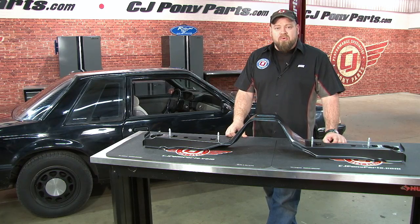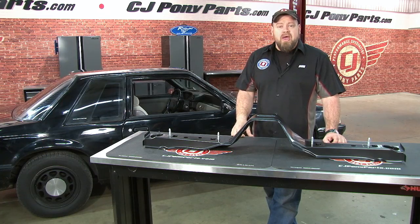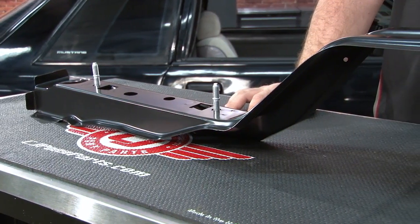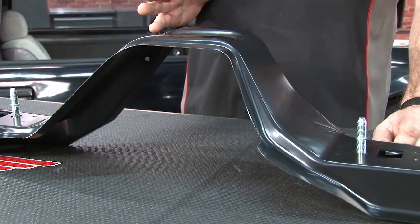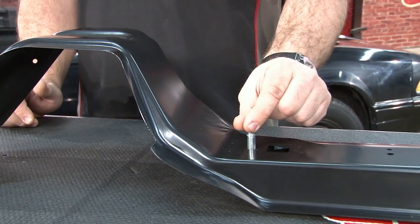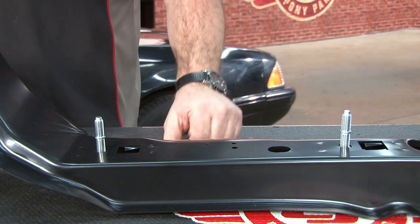The owner of the car plans on doing a lot of the work himself, but one area that needs help is the crossmember. The crossmember is a weldable part and a lot of people have asked how to install this, so today I'm going to show you how using this '91 notchback. More and more restoration sheet metal parts are becoming available for the Fox Body Mustangs — you can get complete floor pans and also this front floor crossmember, also known as a seat platform. This covers your 1983 through 1993 Fox Body Mustangs. What typically happens is the seat rips the studs out of the floor, making it impossible to bolt your seat down properly. If it gets too bad, you have to replace it, and today I'm going to show you how.